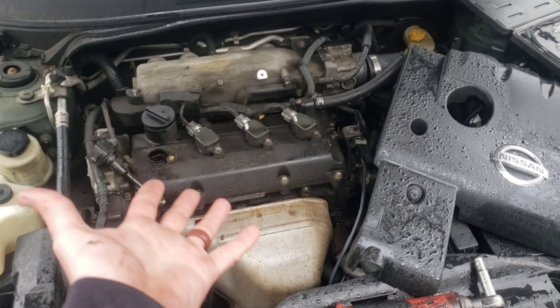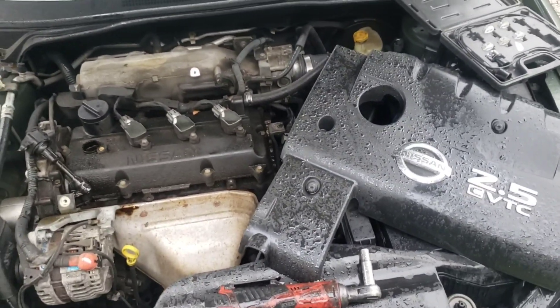Two more things. On the transponder key issue — if you have a bad or missing transponder — your options are: one, take it to the dealership to get a new key programmed and cut; or two, look up a key locksmith in your local area and they may be able to cut and reprogram a new key. That's what I did — I referred my customer to my local key guy. In our case the locksmith was charging about $120 plus tax.